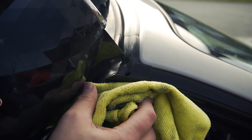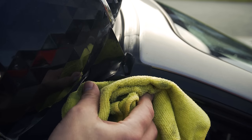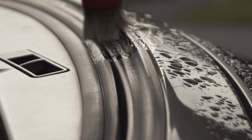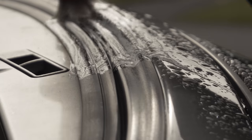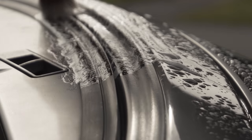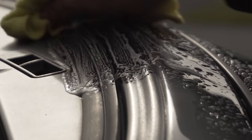One of the next things you need to check is that the water channels are not blocked and are free from dirt. This can be done simply by pouring some water down the channel and checking that it comes out the other end. If not then there may be a blockage. Some blockages can be cured with a large syringe full of hot soapy water — use the syringe to force the water in and push any blockage out. Incidentally, this is one of the main causes of sunroof leaks and it's always a good idea to routinely check that the drains are working properly.